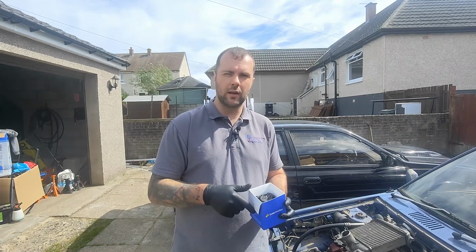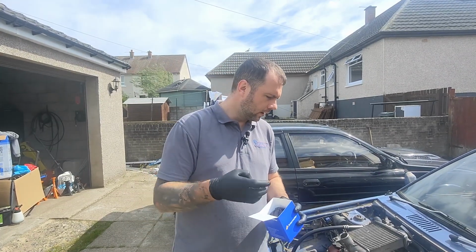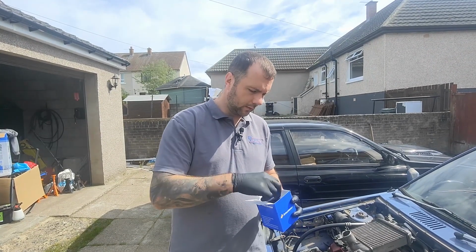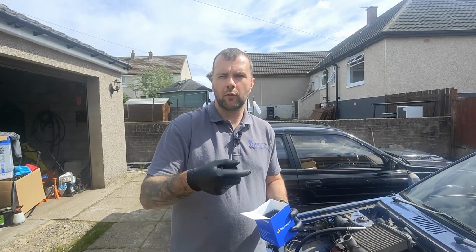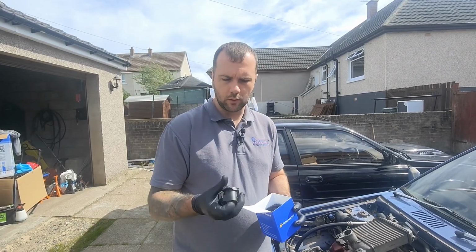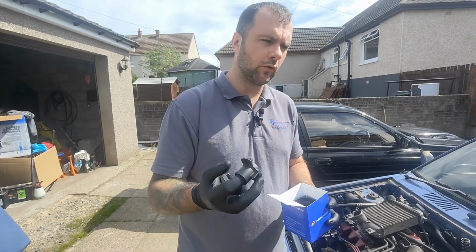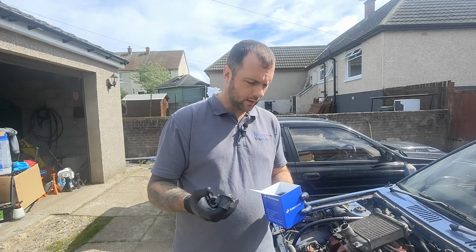This is one of the things I want to show you guys, the mistakes I make. I put the distributor cap on, tried to start the car again and something went wrong. It's then I decided that the cap must be wrong, and I started to buff up and file away the points to try and clean them up on the original distributor cap. But when I stripped it down, I'd smashed the rotor. So something has gone wrong in there. I don't know if it was the wrong distributor cap that went on or whatever.